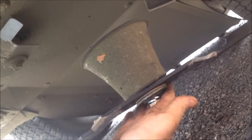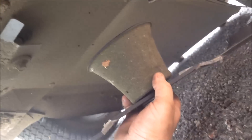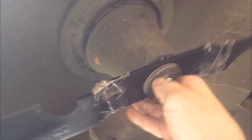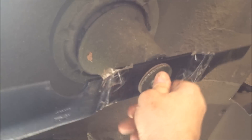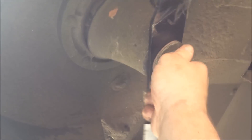Then your cup with the internal washer, and then your big washer goes down in there just like that. Get everything together — it's much easier to do it this way. Got all your washers and bolts and just raise the assembly to the spindle like this, and just use one hand to get everything started.